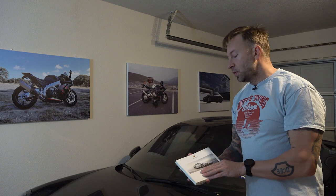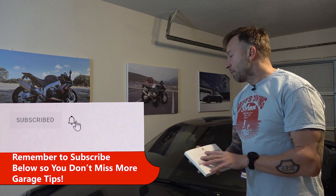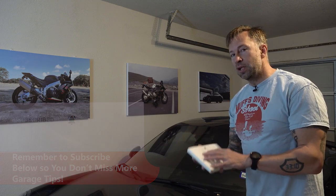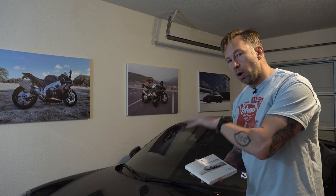Before you do any task, it's always good to check out the manual and see what information they give you, because usually there's quite a bit of information. Porsches are designed by engineers that actually know how this stuff works. When you read the manual, it does say that the battery is supposed to be changed by a dealer — not because we're not capable of turning a couple bolts, but the biggest thing is the battery has to be initialized. The battery charging system is programmed into the computer of this car, and it knows how long the battery has been installed and adjusts the charging patterns according to the age of the battery.